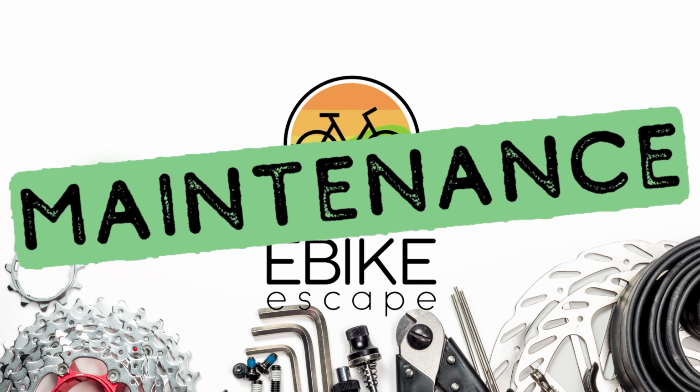So now let's jump into some of the problems that you might be experiencing on any electric bike with a derailleur. What should we check first, or what should the user check first? So there's a variety of things. Sometimes in shipping, this cage here could get bent into the derailleur, and that could cause the shifting to be out of whack. And the derailleur itself could have got bent in shipping, or sometimes it's just from the factory, it's a warranty type of thing. So if something in here isn't in alignment, that could cause the shifting problem.